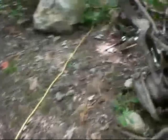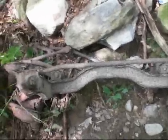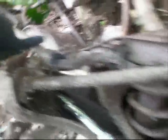People ask what kind of dog he is — I tell them he's a freakazoid. I'm taking the sway bar off this cross member. Got my cheap Chinese ratchet set. Probably a 64 cross member — it's got the big sway bar, which was standard I believe when you had the rear camber compensator, 64 only. It's a 64 because it has four-bolt wheels. It has the reinforcement across the lower control arm. The 65s used five-bolt wheels, and the shock absorber bolt went through that way with a sleeve through the shock — different shock absorber.